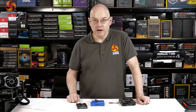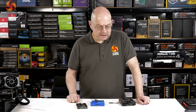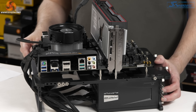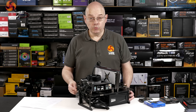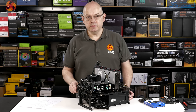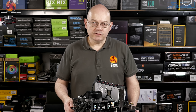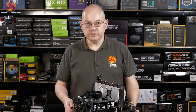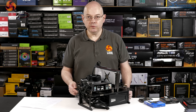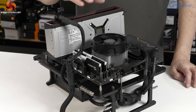In January we expect to see the SN850 with a heatsink — tragically at quite a premium. It looks like they're charging up to £50 for the heatsink, which doesn't sound right, albeit it's a heatsink with RGB. But let's put that to one side. For now we're talking about the SN850 without heatsink, and it has a Gen 4 interface. AMD has been supporting PCI Express Gen 4 for some while now; Intel is just catching up. 11th Gen Tiger Lake in laptops is Gen 4, and the significant thing will be when Rocket Lake comes to the desktop, which will also have PCI Express Gen 4. That's also why NVIDIA's RTX 3000 has a Gen 4 interface. If you want to benchmark Gen 4 products, you need an AMD platform, because Intel currently does not do the job.